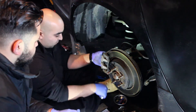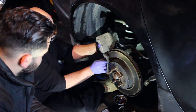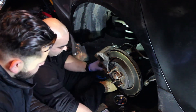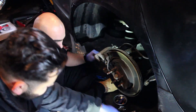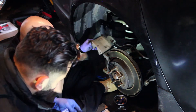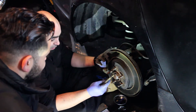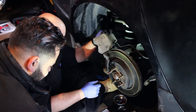What we do is open up the caliper halfway to get the pads out — just use a wrench. And there you have it, those are the pads. You just put in your new pads and you're good to go if you're not changing your rotor. Look how thin — there's nothing left. We're at 125,000 kilometers on stock rotors and stock pads on this car, and it's seen a lot of burnouts, donuts, brake stands, and all kinds of stuff. So they've lasted this long and done well, but it's time for a change.